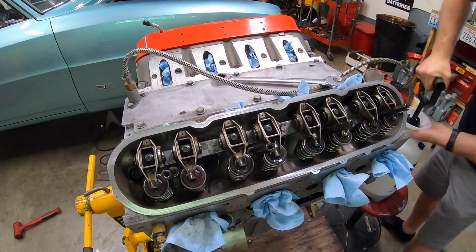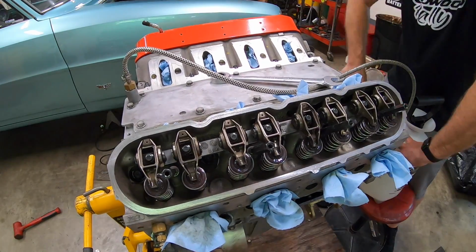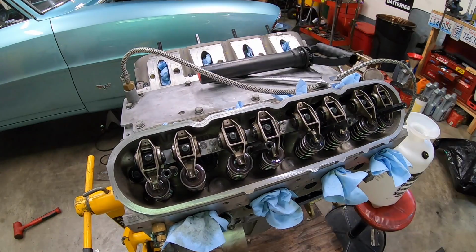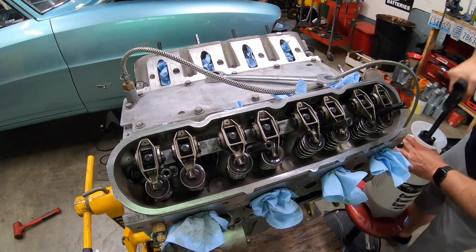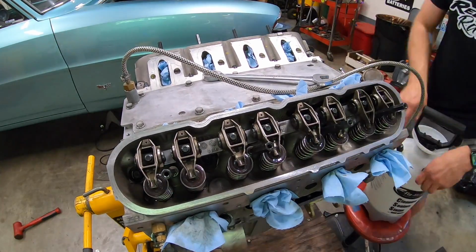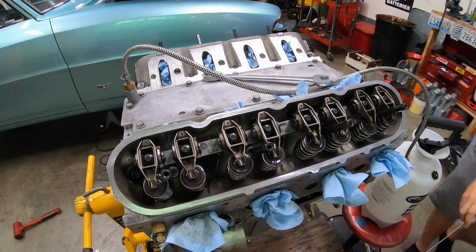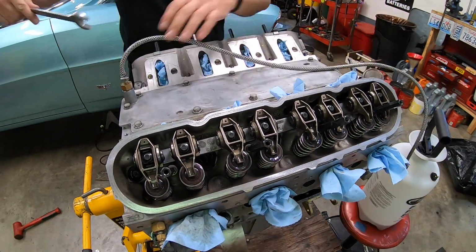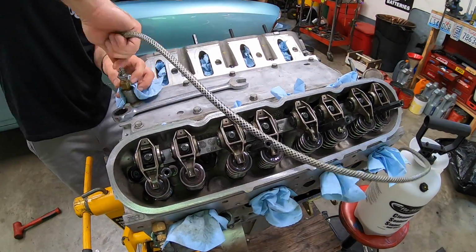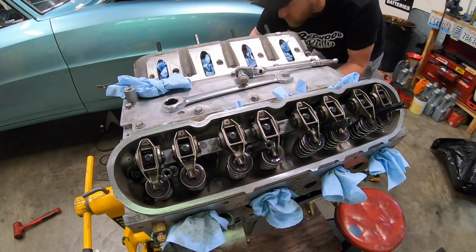So I just wanted to note a few things here. I originally put in 2 quarts, and all of the oil had just gone somewhere. When I was pressurizing it, I could hear it hissing, and I theorized that the bypass built into the oil pump was probably releasing the pressure, because I could hear it dripping into the oil pan, which is one of the reasons I swapped to the other port. I had put probably 4 quarts in it total by the time I actually saw it come out of the rockers in the next video, but as long as you have it in the right port, I think it would probably happen a little faster than that.